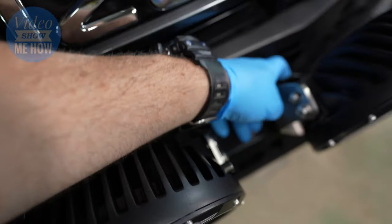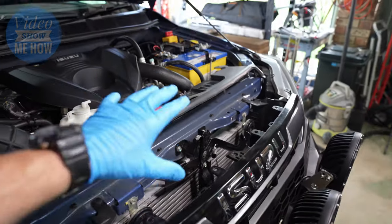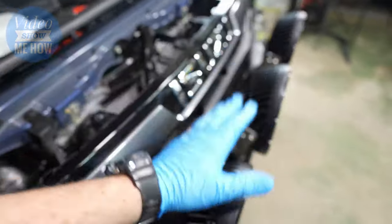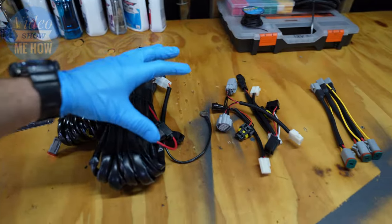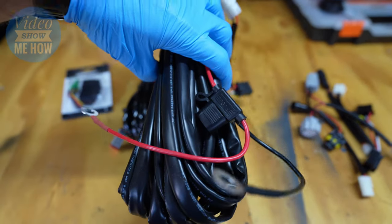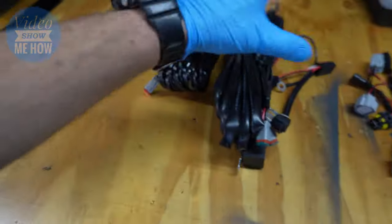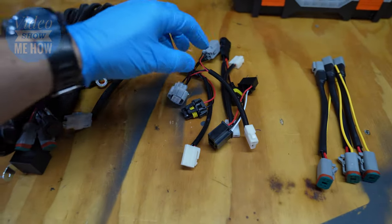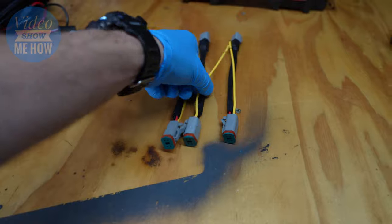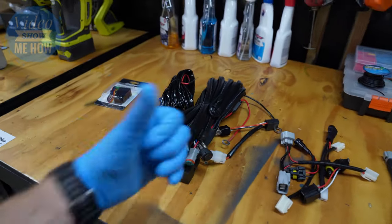You want to feed the actual wire section of each of the lights through your grill so it's coming out the back, and you've got nice easy access once you remove the top section. Then we get stuck into the harness — that's going to plug into our power source and then route back down to connect into the waterproof connectors for the Supernovas. The wiring side of things is actually pretty easy. There are three major components: our wiring harness — which has everything, it's all fused with appropriate size wiring, plugs, and even the switch for in-cab. We're going to be using one of the factory style switches instead. Then we have the connectors — no crazy cutting or splicing required. And then the actual connectors for the spotlights themselves. The little yellow wire is optional — that's for our daytime running light.